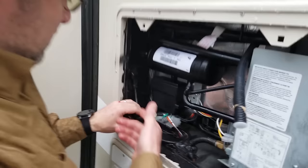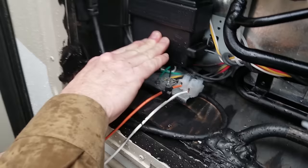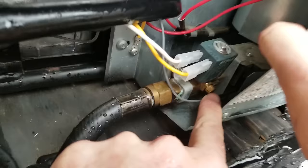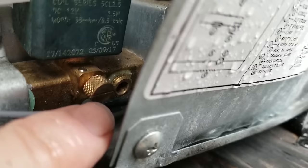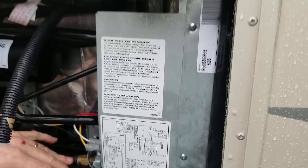So it's already unplugged from shore power. Here we have the 12 volts feeding the refrigerator. We have a control board right here, and here's our gas valve. To see if you look down in here, there's a little crosshair on that valve — it's going in the direction of the valve. You see that little line on the valve; that tells me the gas valve is open. I just rotated it and now it goes up and down — that would be closed. So that's the first thing I would look for. I just opened it.